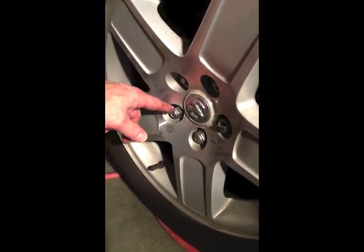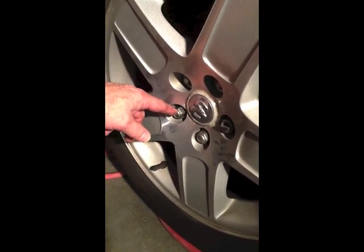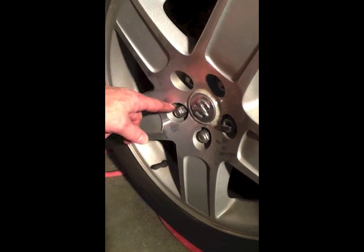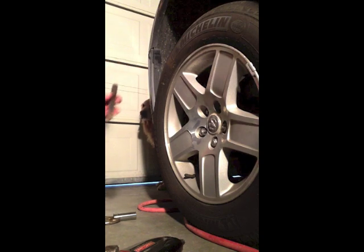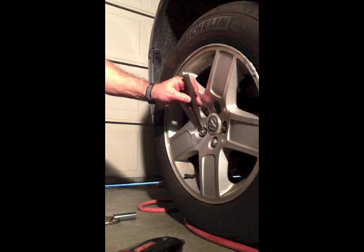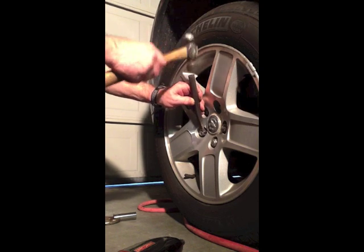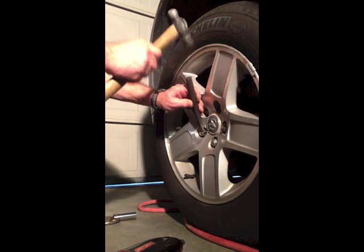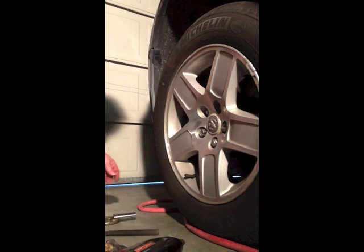So what has to happen now is that very carefully — because this is an aluminum wheel — you have to chisel the outside skin off of this bolt with a metal chisel and pry and remove all of the aluminum around the inside bolt. Take a chisel, not to get to the wheel, and chisel this little raised section off right here. Do not hit so hard that you miss the chisel and hit your aluminum wheel — it will cause permanent damage that you will not be able to recover from.